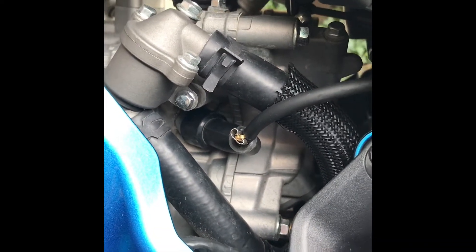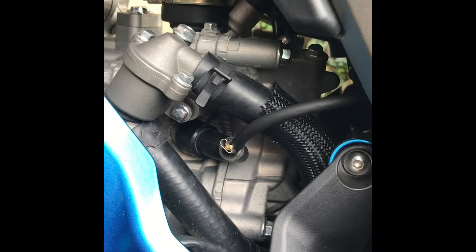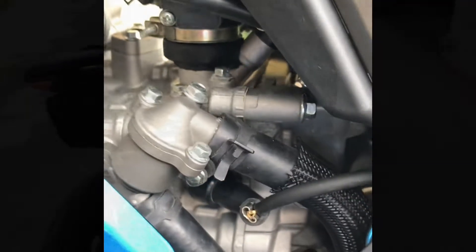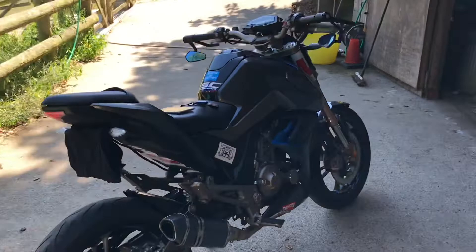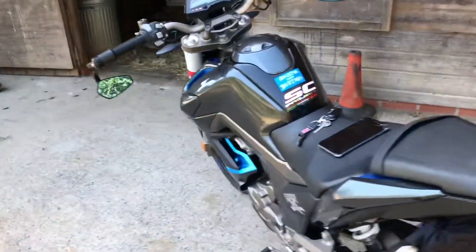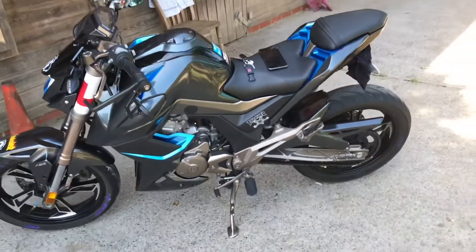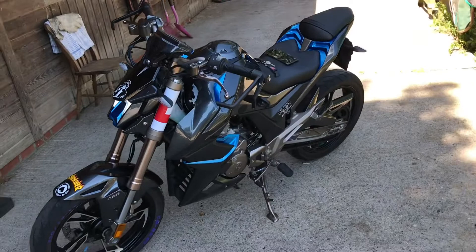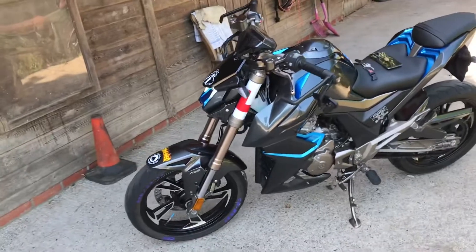It already suffers every time I wash it with water getting on the spark plug and in the HT lead whenever you use the pressure washer — it doesn't like starting after. The HT lead and spark plug have been pulled out quite a lot, so I'm assuming that weakened it underneath. I'd just change your HT lead straight away to a good brand. Otherwise you're going to have a problem like me. Just waiting for my mum to bring me some tape so I can try and get on the road. I'd just put some copper wire in and tape it — that did me a week. Don't just call recovery and spend hundreds of pounds — you can bodge it to get you by.